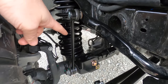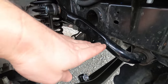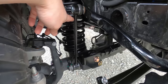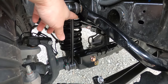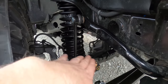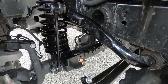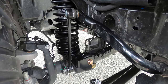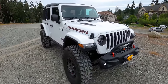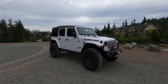With the suspension too low in the front, you can see the sway bar is at a really high angle. It should be closer to parallel or flat at ride height. The Teraflex end links are quite long — about the appropriate length — but if we added another two inches of lift, the sway bar would dip down much closer to parallel, which is the right spot. So there's a whole bunch of stuff not looking or working properly simply because we're lower than we should be. I'll add spacers in the meantime and get proper-rate coil springs in as soon as possible.